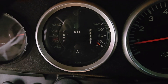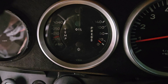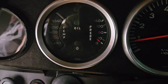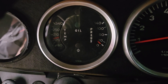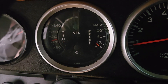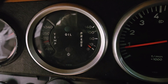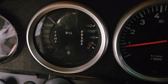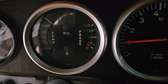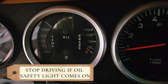The reason for this can be a lot of things. There's a new pressure sender in the car — pressure senders are somewhat reliable — but we have all of the wiring and connections from the engine all the way back to the gauge. We have wires that are 43, 44 years old that have a certain level of corrosion. All of those factors will influence the gauge reading and how accurate it is. That's what was always told to me from day one at the dealer: as long as you step on the gas and you see that gauge move, life is good. As long as the safety warning light does not come on, life is good.